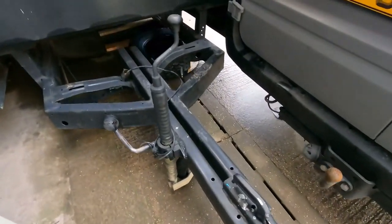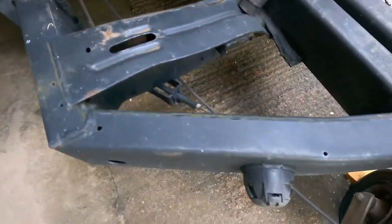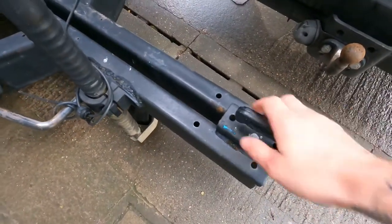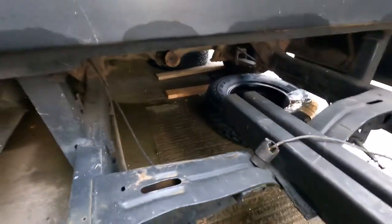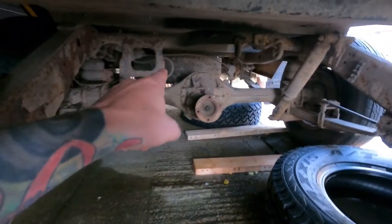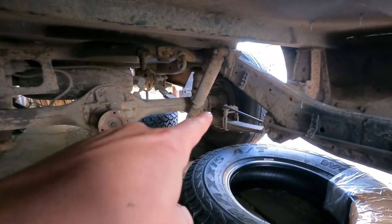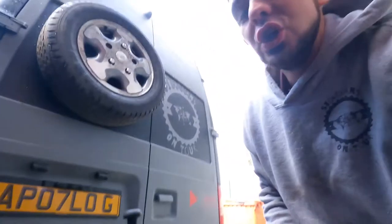Basically this is your existing chassis here and they've just welded this in and added this tow hitch. It is not a brake tow hitch, so that's no good to us. But as you can see, if we look under there, we have the brake lines coming from here and here going all the way back up — it's even got the diff. It's literally just been hacked off. We've got the diff there, spare wheel under the back, and all the brakes intact, so it shouldn't be a big deal to get that sorted.